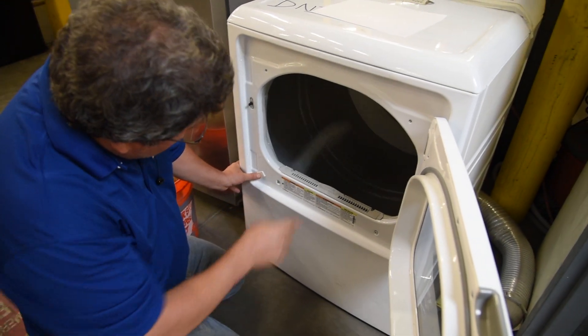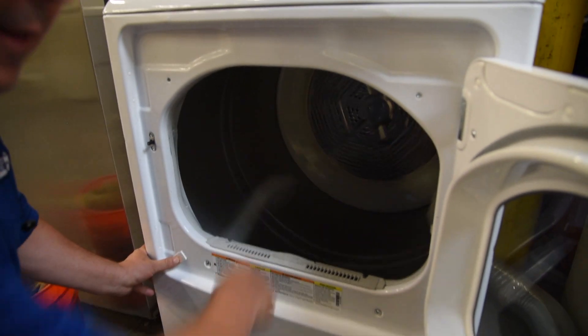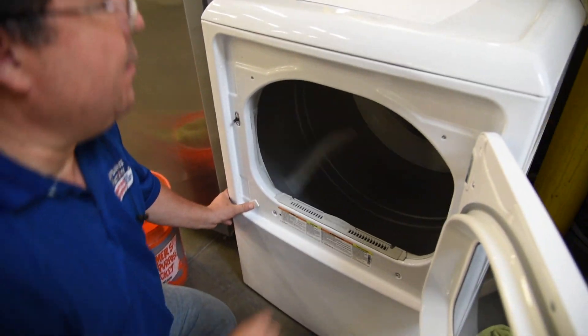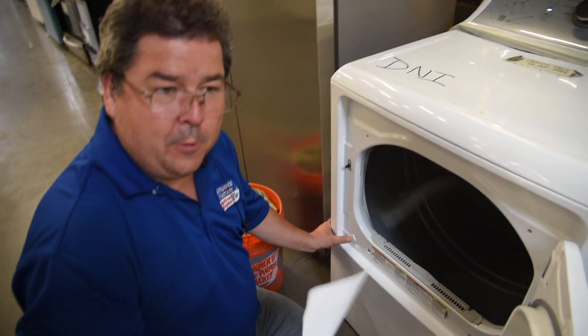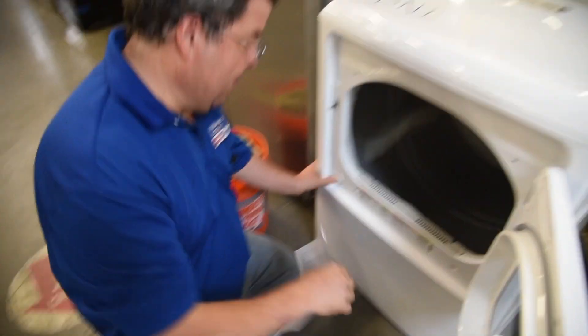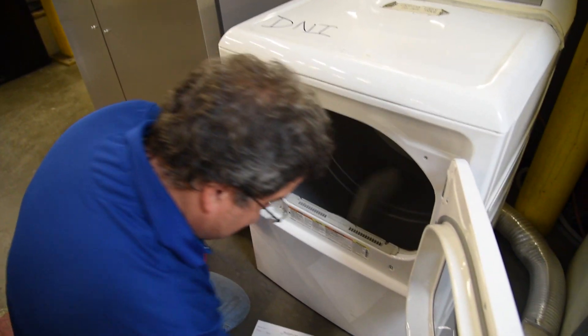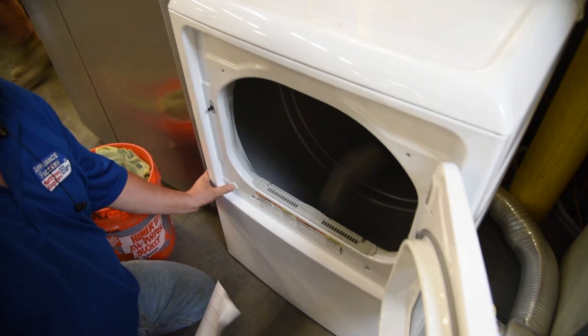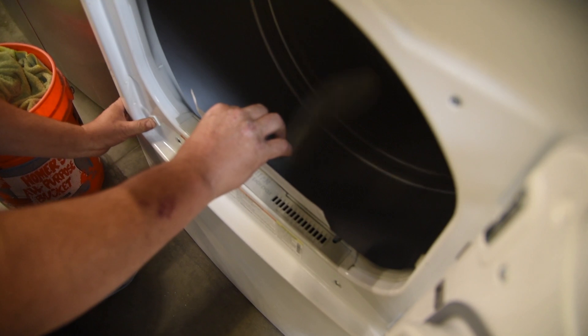The way it works is air comes in from the back, goes down in here and then out of the unit. What we want to find out is: is my dryer the issue, or do I have a vent clog somewhere else? What you can do is take a normal piece of paper — this is where the suction is supposed to be on my dryer. That's what brings the air to heat it down. If I have no air flow, the heat isn't going to be running properly. So I want to put a little piece of paper over it.